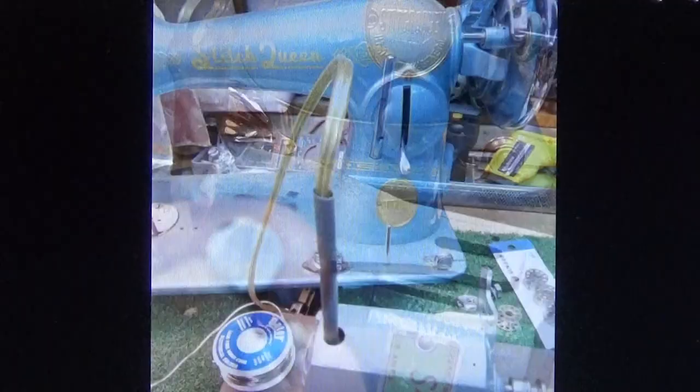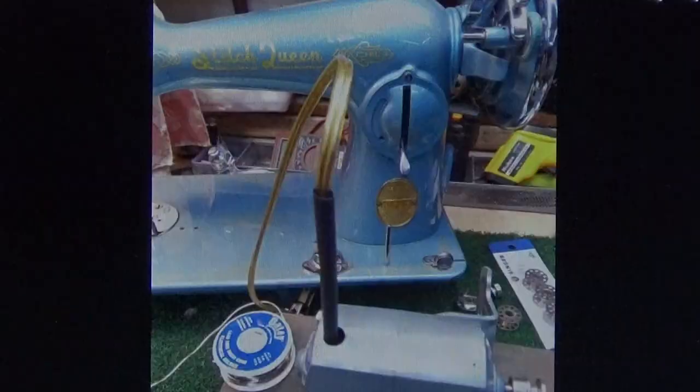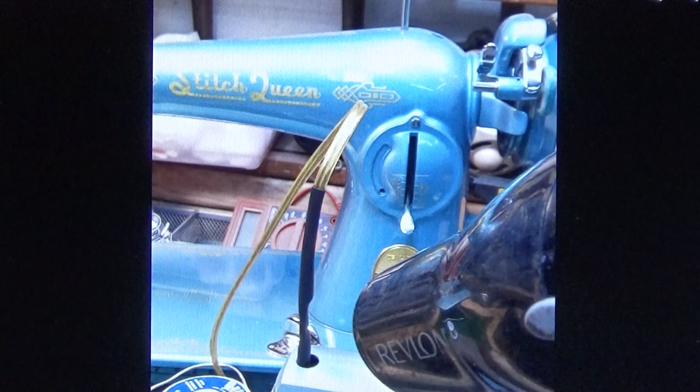And also I like to add this shrink material as well to reinforce that wire where it's going to be at high flex points on the motor, so that that wire isn't stressed and it doesn't prematurely break or get damaged. So that's what I'm adding here, is some of that shrink material. And it also adds a nice insulation as well. And again, you use a hairdryer to heat this stuff so that it shrinks onto that wire and creates extra insulation and extra stability.